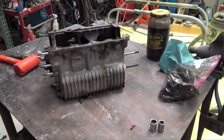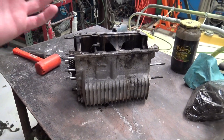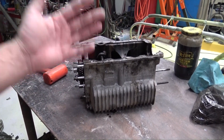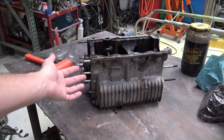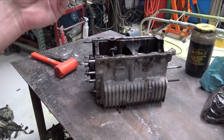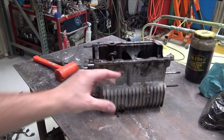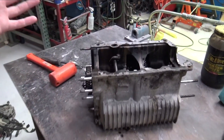Welcome back to the channel. Today I am refinishing the oil pan for the Mini Cooper. As you guys saw, this thing is pretty grimy. It's cast aluminum, and even after you clean it, if you don't seal it, the pores of the aluminum just get really grimy once oil gets on it. With dirt it just gets grimier and discolored — it just doesn't look good.